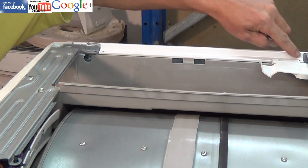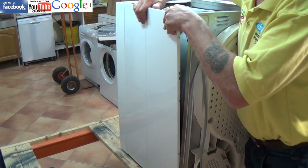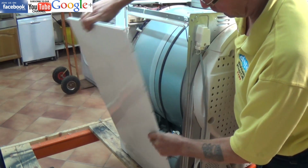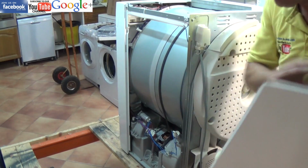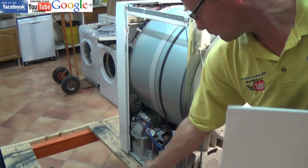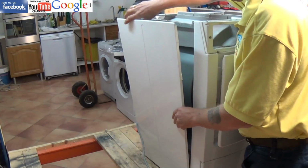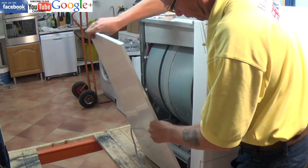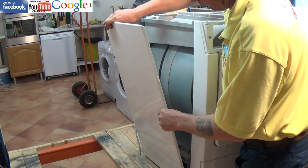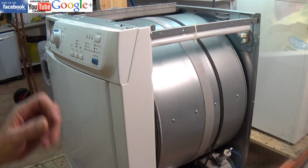And you need to check along the top. On some models they did put screws at the top, and then the side panels come out, and you will notice a plastic clip which locks into the front when reassembling. And then of course you've got the lugs on the bottom, and again just taking the other side off from a different angle here, and you can see this plastic white lug that slots into the main cabinet.